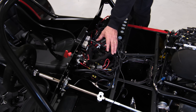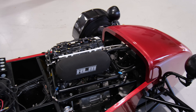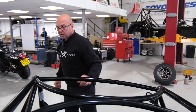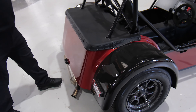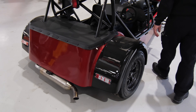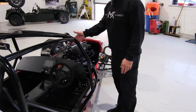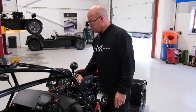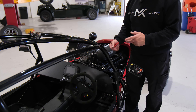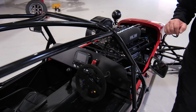It's a great bit of kit, can't fault it really. Under here the ECU and loom just need a little bit of tidying up to finish off. Everything else is done - we've put the IVA exhaust on, and emissions are all good on this one. It has to meet the criteria for that. On the rear of the car we have the fog light up in the center and the LED light pack underneath, all done and detailed. We'll probably change the mirrors out to some little race ones at some point. It also needs a center mirror for the IVA. Once you put the scuttle on, there's just one little job to do - the immobilizer - because you need two forms of immobilization: a key is one. If you have a steering column lock that's automatic, but if not you need an electronic immobilizer.